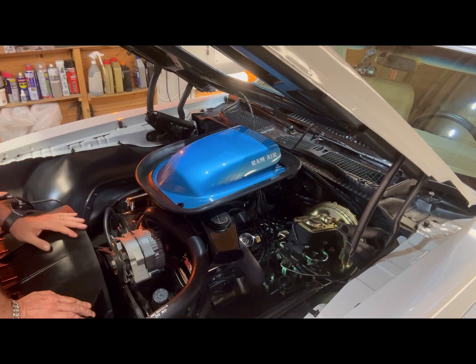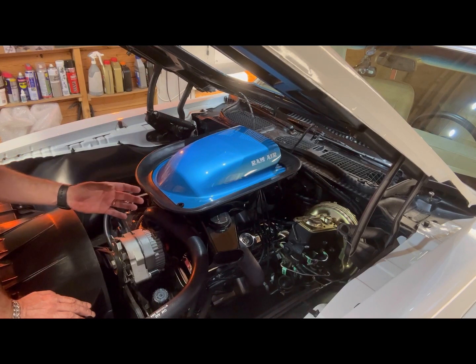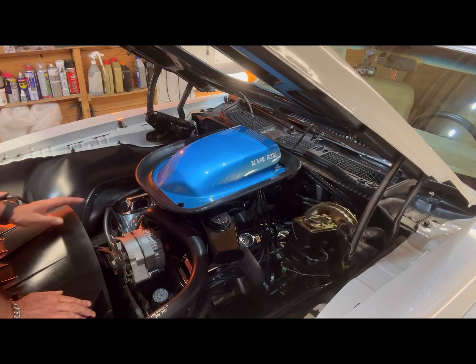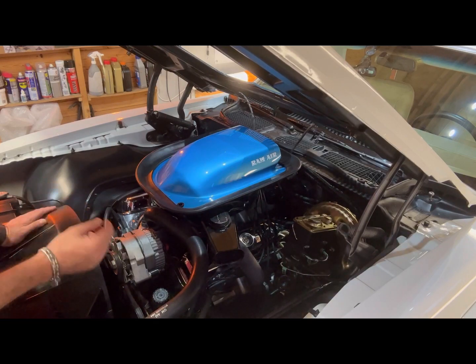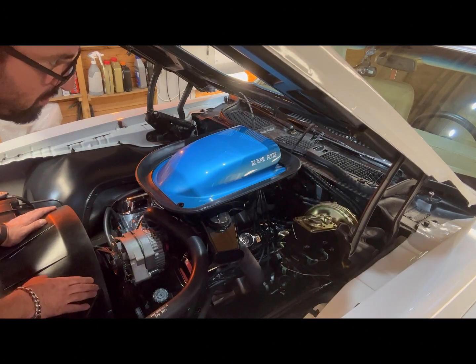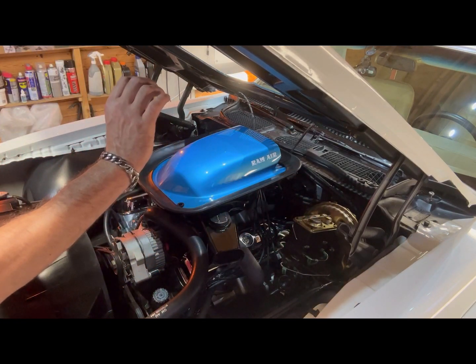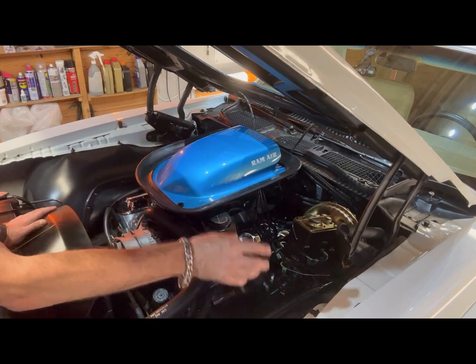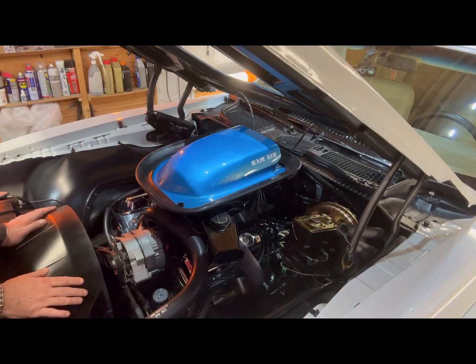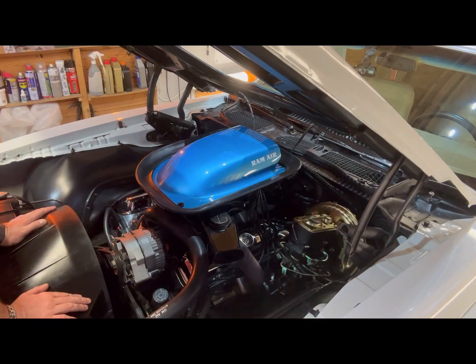While I've been under here, I've literally undone the entire loom, traced some old wiring harnesses — there was an old TCS system on the car and the wiring remained for that — and any old redundant harnesses or connections I've cut out. I've then put all the loom neatly into conduit, splitting what was one big loom into four or five different looms in separate runs of conduit, so I can actually get to things more easily in the future. I think it just looks nice and neat, and it's got to protect the cables better than just binding it all in masking tape. I had meters and meters of the stuff once I'd undone the loom.